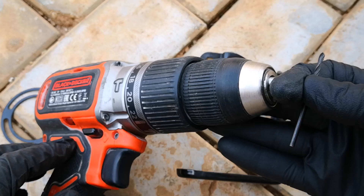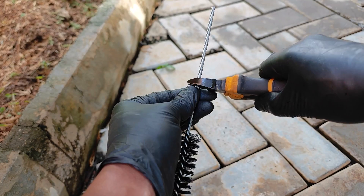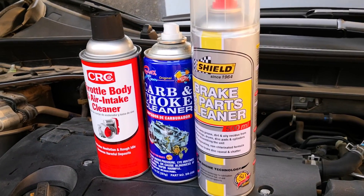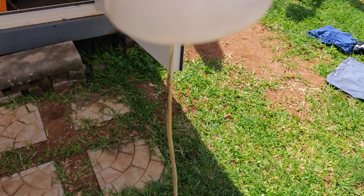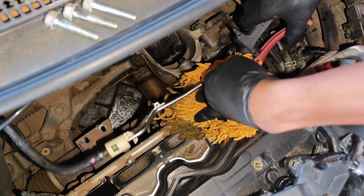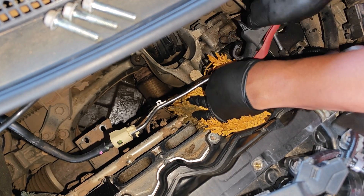The main tool you're going to need is a drill and these nylon brushes, which you can cut down to size depending on the length of your intake port. I also used carb cleaner and a water-based engine degreaser, as well as an extraction kit for removing the fluids. Blowing out with compressed air is a nice-to-have, but you can simply use a rag to soak out the last bits of fluid.